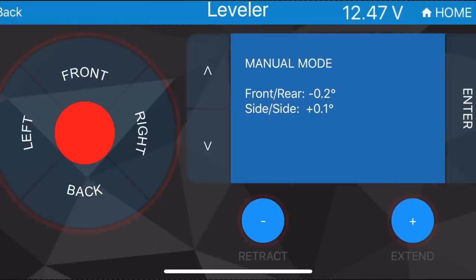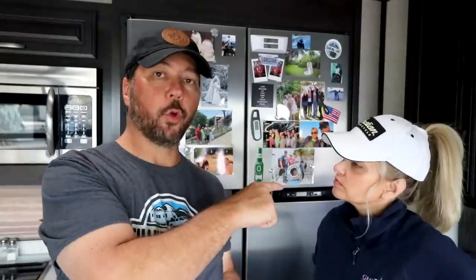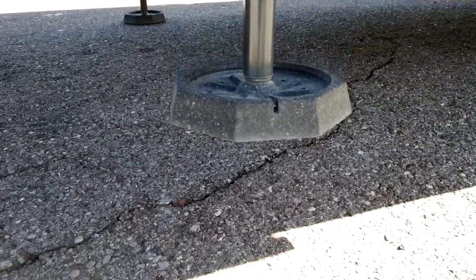I can go into manual mode, hit enter, and then pick whether I want to extend or retract, and then pick front, back, left, or right. I'll typically use the control panel outside to put the front jacks down just to the ground, then use the app — it tells you right on screen how far you're off positive or negative each way. I put all six jacks down and get it as level as possible. If you're already pretty level you shouldn't have to do much — we've even stayed overnight without putting the jacks down at all, but we just like the stability. Just don't try to lift your truck off the ground or put jacks down on a severe angle.